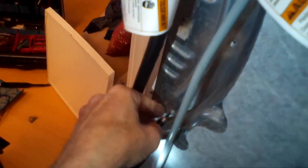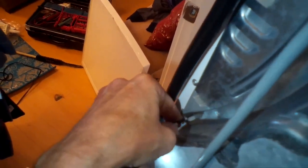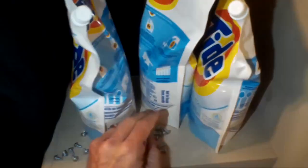We're zipping out these lower screws — these are the ones that go into plastic. Once we get these out, we can use a standard head screwdriver or a paint scraper to gently pry off the panel. You can use compressed air in a can, an old toothbrush, or a wire brush to knock away lint accumulated on the element. On the condenser version of this dryer, there's also a big filter in the front that's important to clean periodically.